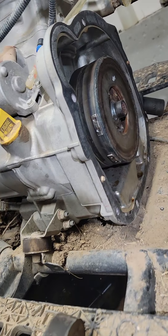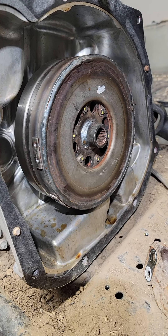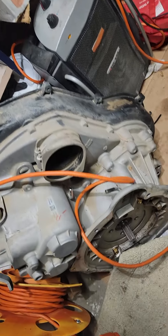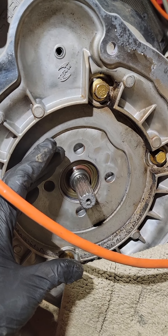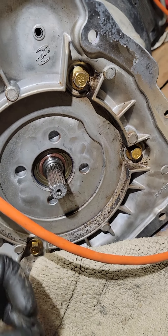See this coupler right here — these couplers are different. On the 2009 to 2011 they're different; they got splines on them and it's a little rubber seal, a rubber thing in there, and that nut will back off. On the transmission on 2009s and 2010s there's a bolt right here that holds on the coupler.